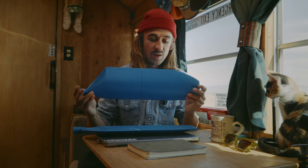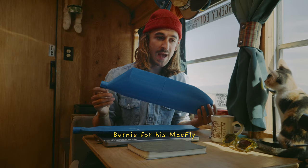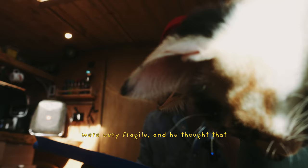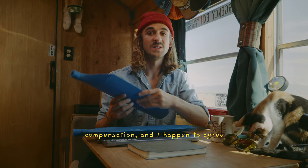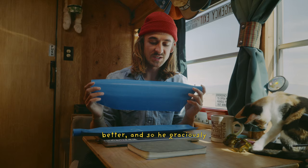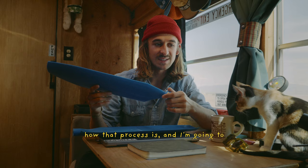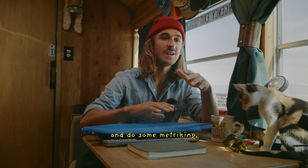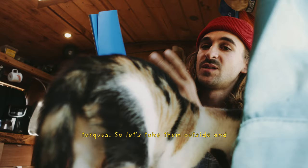These fins were created by my friend Bernie for his MagFly with a Thor 303 on it. He did not like the standard aerodynamic torque compensation fins that came with the MagFly. He thought they didn't provide enough compensation, that they were very fragile, and that they were very inefficient because they use a very high angle of attack to achieve the torque compensation — and I happen to agree with all of these things. He knows that I fly a Polini 202 and I'm light, so I also experience quite a bit of torque. He graciously gifted me these two fins to test today. I'm going to install them on my MagFly, show you the process, fly it, and then do a back-to-back comparison measuring how fast the paramotor turns a full revolution at full throttle due to torque.